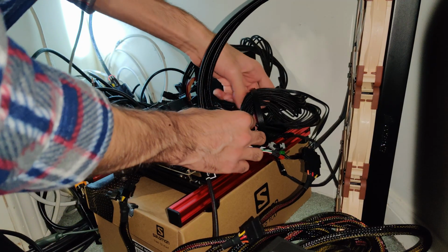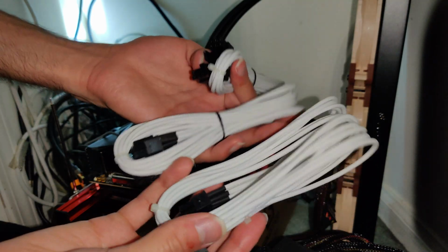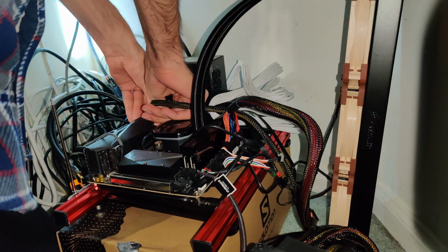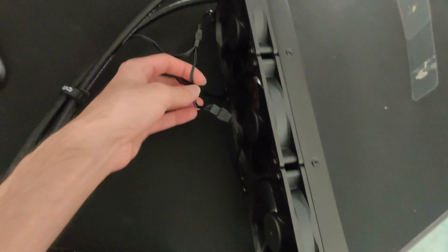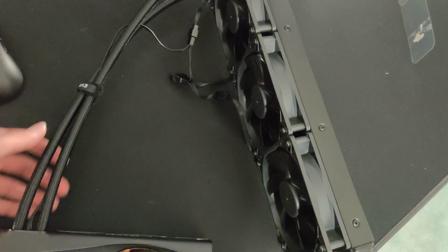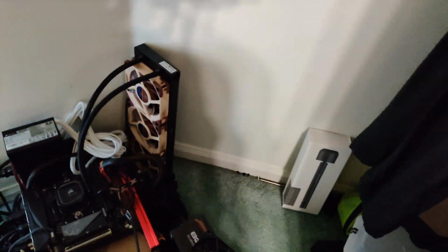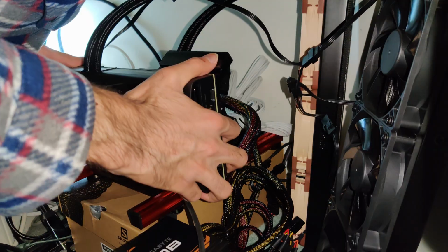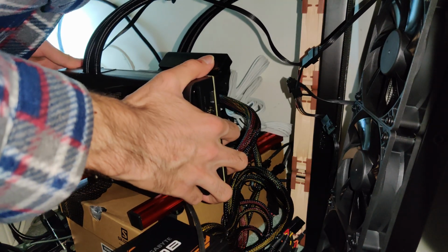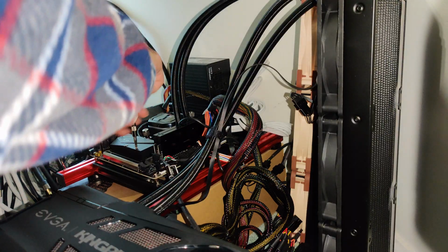Alright, this is dubbing from March 15th, 2021. The video was recorded on December 18th, 2020. So I was trying to run 2 power supplies so I didn't hit a power limit. And the reason why this didn't work, long story short, I know now. You have to put a paper clip in the 24-pin connector to trick the power supply to start up. You can buy a little adapter off Amazon to do it, but I didn't know.